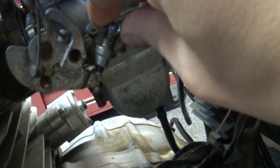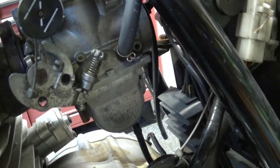And only then, just then, the bike idles temporarily, but you know, it's not right, it's not healthy. You don't want it to be there. As soon as I release it, even a couple of turns, it stalls. So that tells me, I believe, the mixture is a little bit too lean, or it's running too lean. Maybe not the mixture, but it's just running too lean. So I wanted to have it at least halfway there, so I have some room for adjustments one way or the other. But if it's fully maxed out, that's not a healthy way to go.